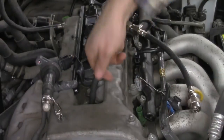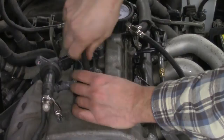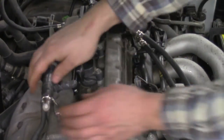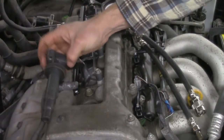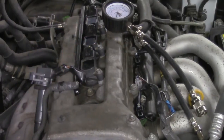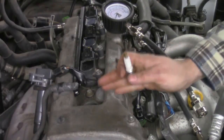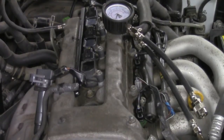Go ahead and disconnect all this stuff, put our spark plug back in, reconnect our fuel injector. Once our spark plug is back in, start it up again and run it just to clear out that cylinder, make sure everything is good, then shut it off and move on to the next cylinder. Keep that progression going from cylinder to cylinder and document every single cylinder. That's how you perform a running compression test — thanks for watching.